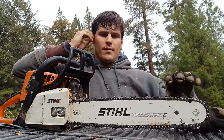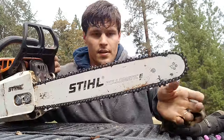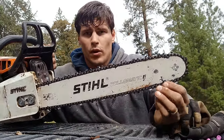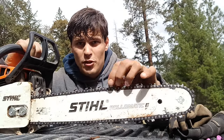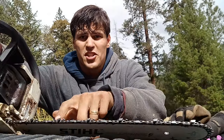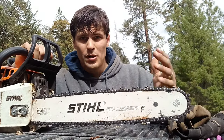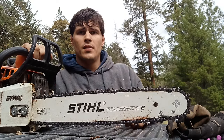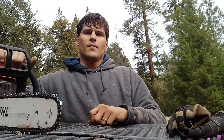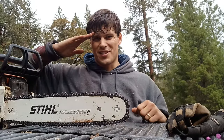I just did it! Okay guys, it worked — and I thought it would because I've done it before. That is how you shave the burrs off the bottom of the chain if they're too big to fit where they're supposed to seat in the bar. That is how you shave off the burrs by using the chainsaw's own momentum. Thanks for watching — Maximus the Fourth here, signing out. See you next time.